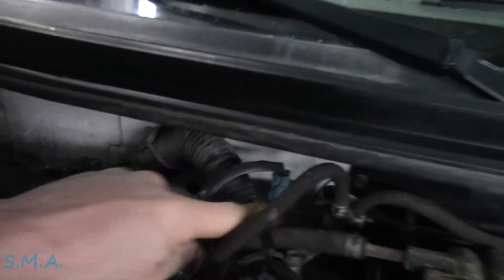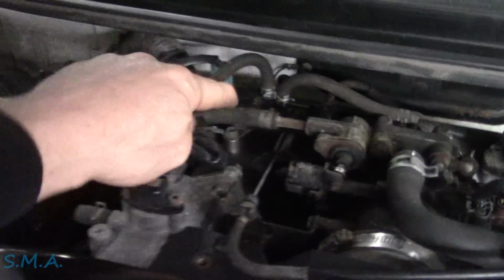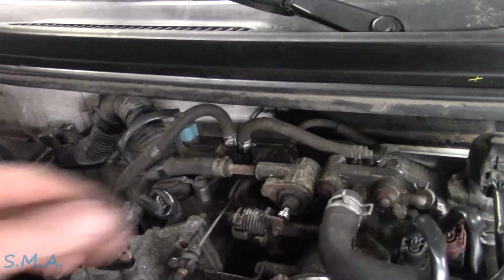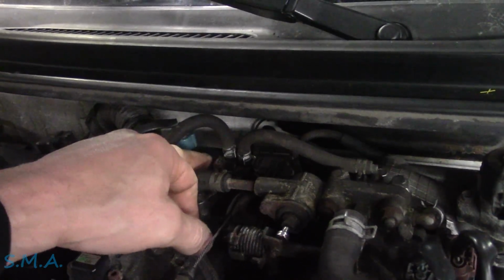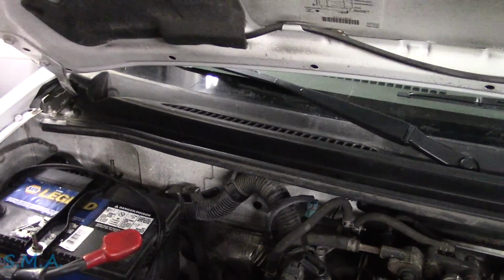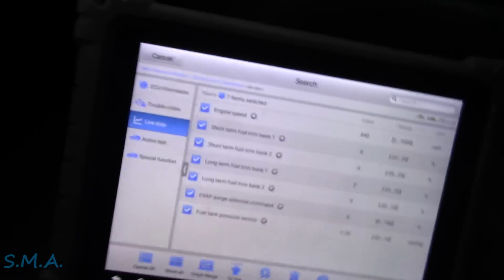However, some solenoids can go bad when they're hot or cold. As they get hotter, resistance goes down, all of a sudden it shorts and the PCM tries to turn it on and poof, up in smoke. So we just pulled the little guy outside.